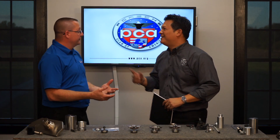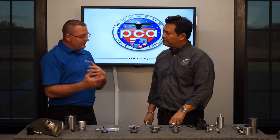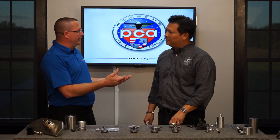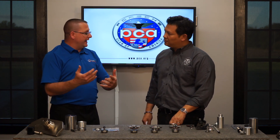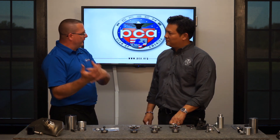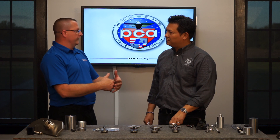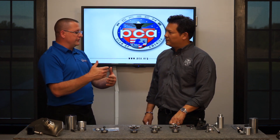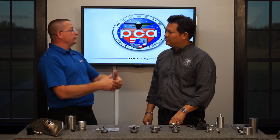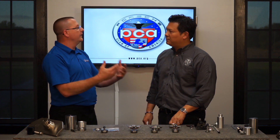Somebody told Jake that you could not extract the bearing, and you just don't tell him that, because he'll find a way. At that point he was on a mission to extract the bearing from the engine, and he succeeded — not very easily, but it just took some old 914 pieces he had laying around, some stuff from a local hardware store, and a couple of evenings. He fashioned a tool, which has been refined many times. LN Engineering now sells those toolkits to pretty much everybody doing this job. It's a simple procedure if you follow the directives, and the procedure has been revised as new things were learned — like don't try to save an engine by changing a bearing if you need to pull it apart.